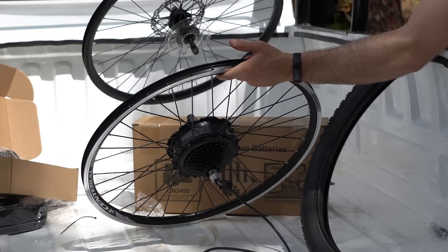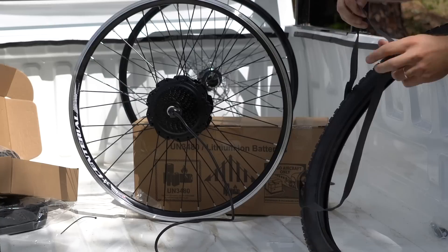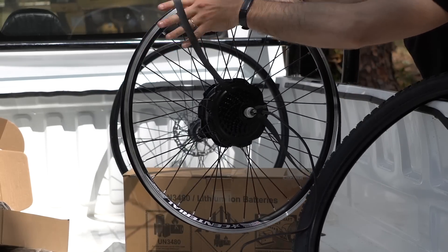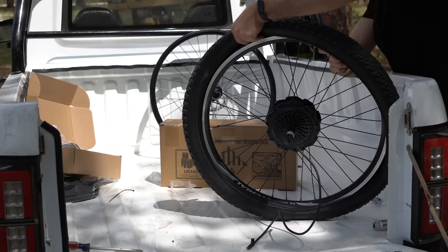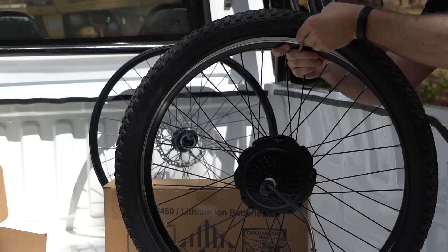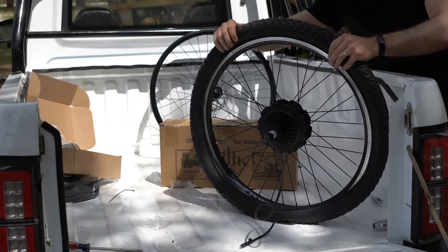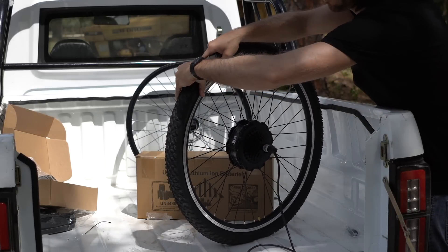The rim strip is a piece of rubber that covers the holes so they don't cut the tube on that sharp edge. I'm going to pull the old rim strip off this rim — just grab the edge and it slides right out, kind of looks like a big rubber band. Now I'll transfer it onto the new wheel, lining up the valve stem hole with the same hole on the new rim. If you forget to line it up, you won't be able to put your valve through the rim. Then seat the bead, line up the valve stem, gently feed it through, and work your way around seating the second bead. With big mountain bike tires you can do this by hand.